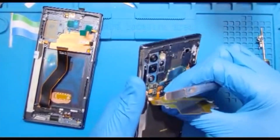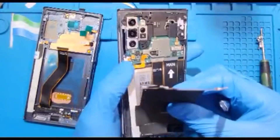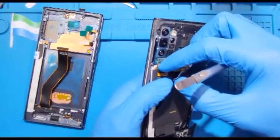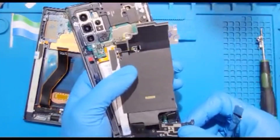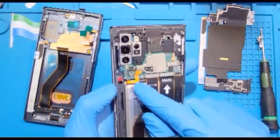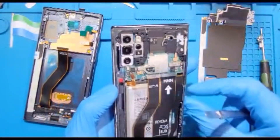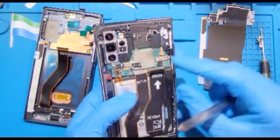After taking out all the screws, remove the panel. Then remove the magnet charger — disconnect the magnet charger from here. Take out and disconnect the sensor for the pen. Remove the speaker and put it to one side. Then disconnect the battery.